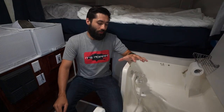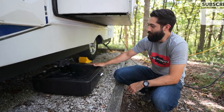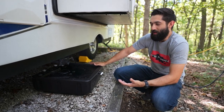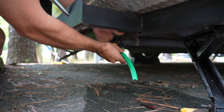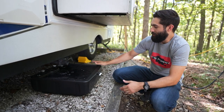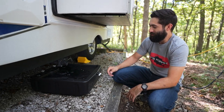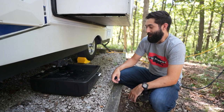The only difference between the shower and the sink is where it drains. Some pop-ups combine them into a single gray water outlet or a gray water holding tank, but ours has a completely separate gray water drain system. We're trying an oil catchment pan from Walmart instead of the blue aquatainers we used to use for gray water — it slides really nicely under our pop-up, which sits low to the ground, and has a huge collection area. So far so good — it might be something to consider if you have a low-to-the-ground pop-up.